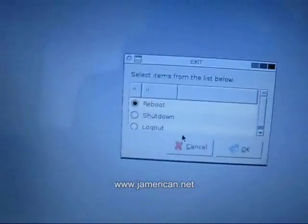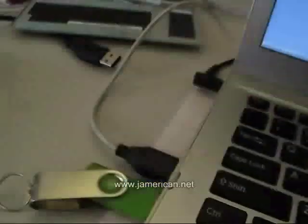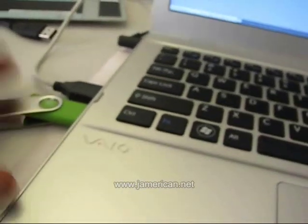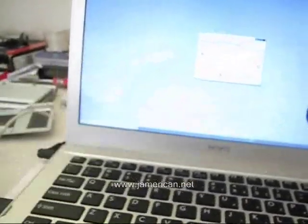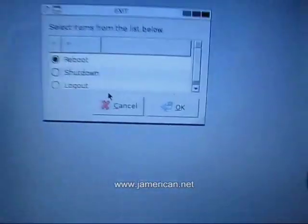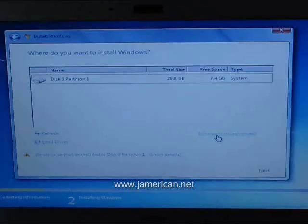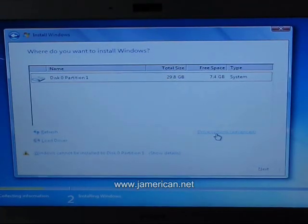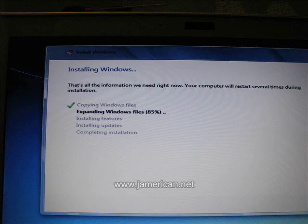When you go to reset, you're going to have to be very quick because you want to boot into Windows now. Take out your GParted USB and plug in your Windows USB or portable DVD drive — that should have your Windows 7 disk already burnt and ready to go. Select the only partition available to you and push Next. Windows should install as normal, so just allow it to finish.